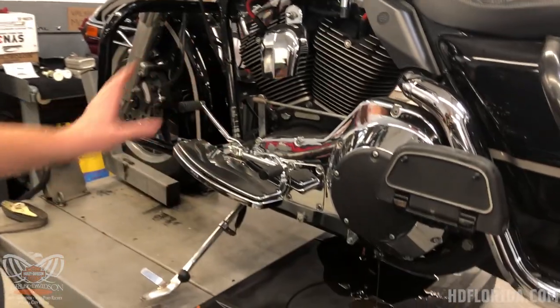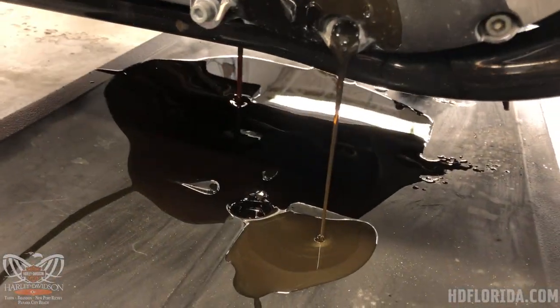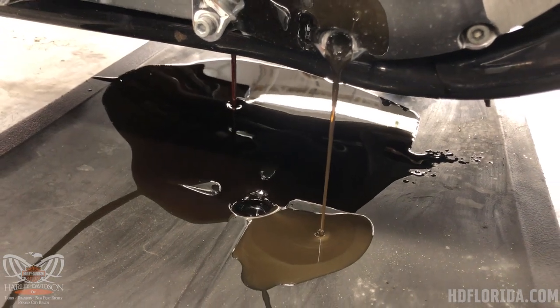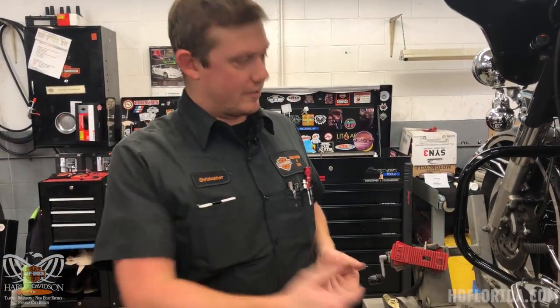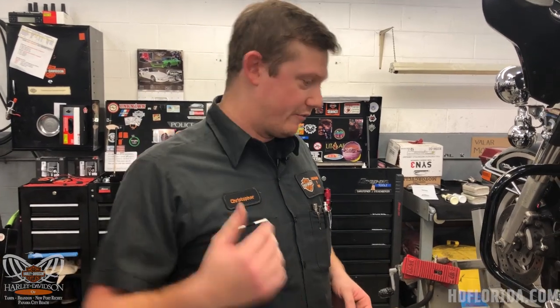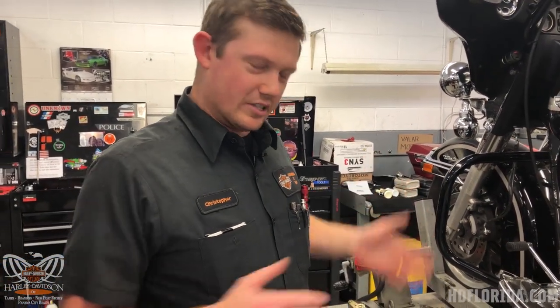The primary is a different color because of the clutch plates — the friction plates. They're always working as hard as they can every time you're riding, whereas if you have an easy ride your transmission and engine might be fine, but your clutch is working back and forth with every gear, every stop, every go. So that oil always looks a little more off.